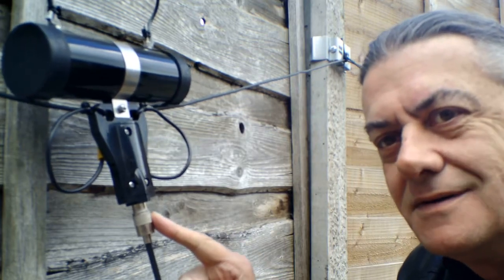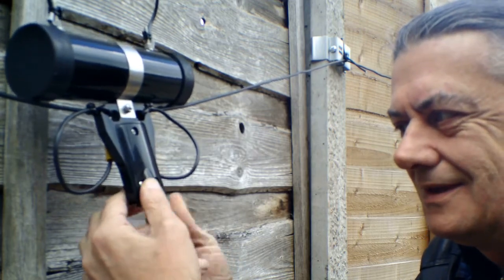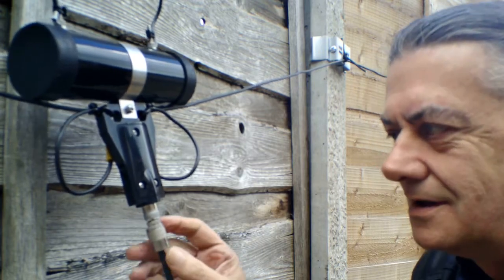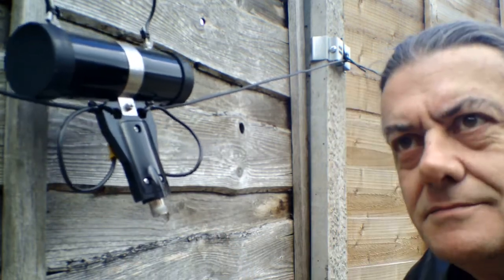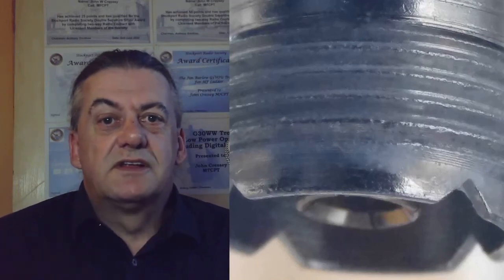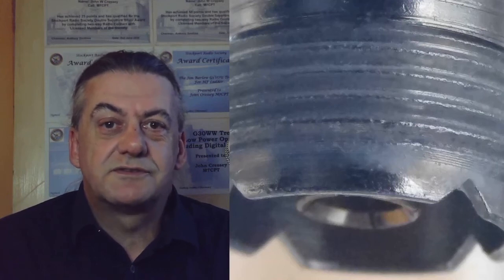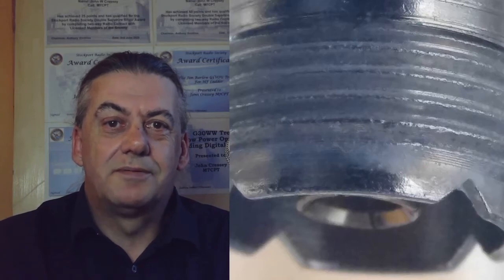I suspect my first problem is right here. And there you go — I'll give you a close-up inside, but it's oxidised. As you can see from this image, there is clear oxidisation on the aluminium. This is a good indication that water has been getting into the plug, even though it was screwed tightly. So now I have to clean off the oxidisation and reseal the plug properly this time.